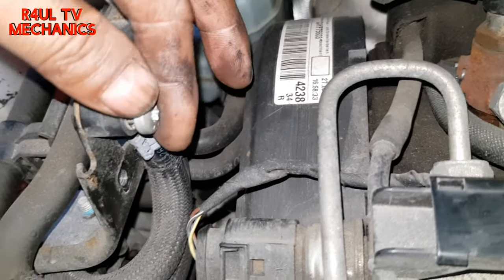Okay guys, I've put the O2 sensor back on — not tight or anything. So what we're going to do now is just put it back on, put that pipe back on. I'm going to start it up, let it blow through and everything. And then hopefully the DPF light might come on now, but don't worry about it — let it blow through and it should be all right. As you can see, it's blowing out smoke and everything. That will clear up and that is a good sign. Basically when you're regenerating it should be something like that — all the rubbish, all the crap is coming out.